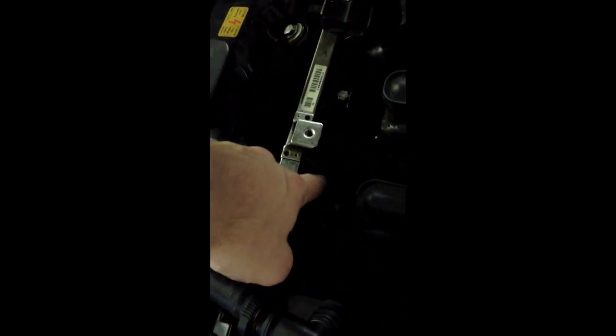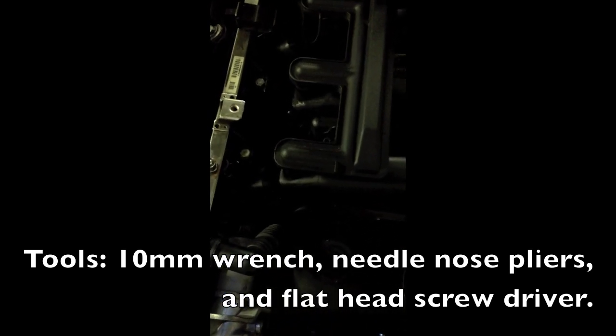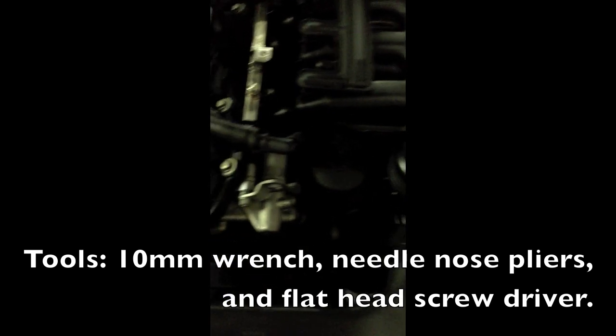The main trick to reassembly is to put the fuel injectors into the rail before you put the rail into the engine, because you have to push it up into the top of the rail so the fuel injectors are already seated before putting them into the engine. Besides that, it's just a 10mm wrench to put this back in. I only used needle-nose pliers, a 10mm wrench, and a flat-head screwdriver. I bought the rings online — not very many tools, and it's a pretty easy project.